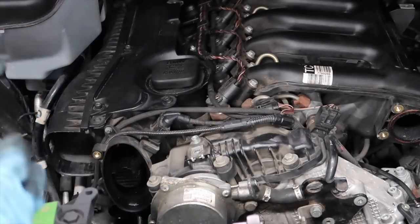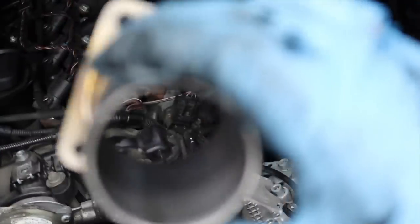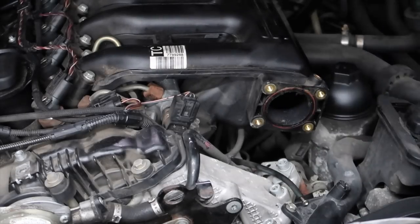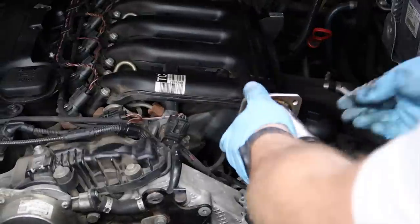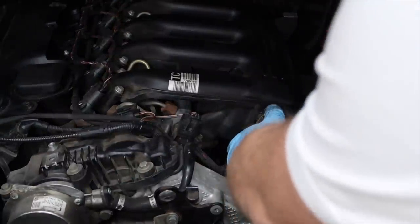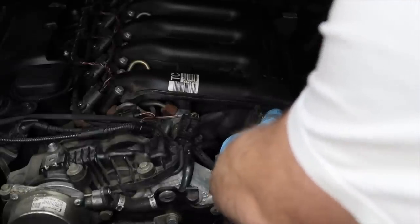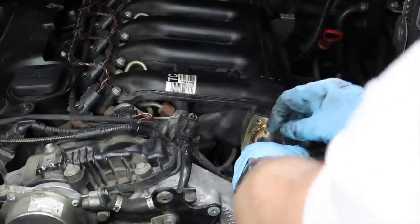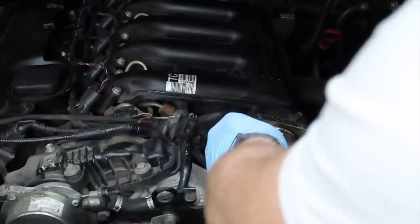As you can see, blanking it off does make a lot more space in the engine bay and everything is easier and more accessible. We're going to go over now and blank the EGR valve off. This is the EGR blank itself and here is the EGR gasket — we're going to put it between. We'll leave the O-ring in because it's not going to leak there anyway. We're going to fit this now. Don't lose the bolts — we can get to the lower one a lot easier than before, so we'll screw the lower ones in first.